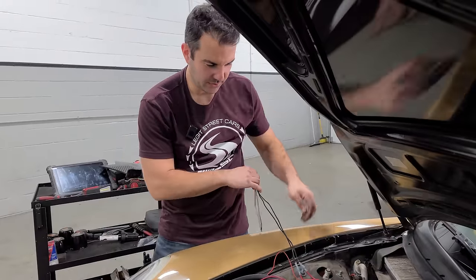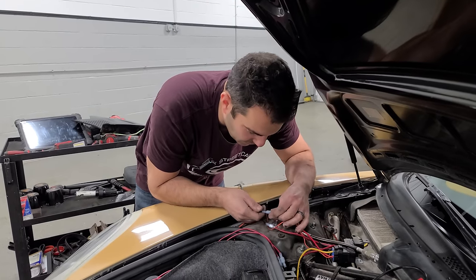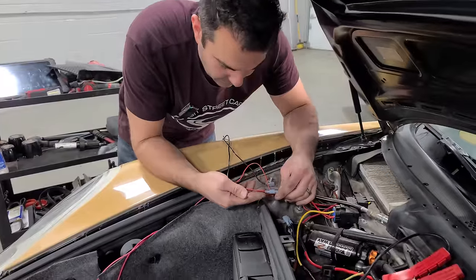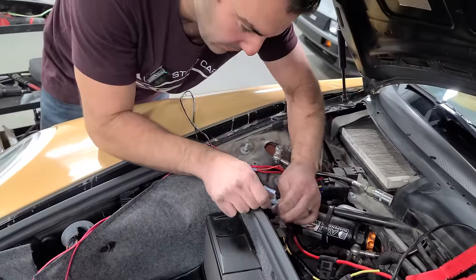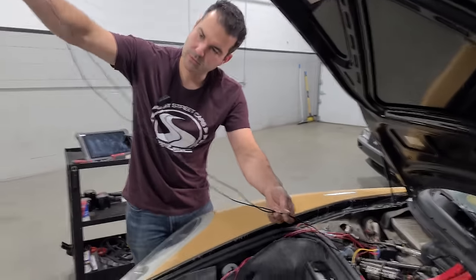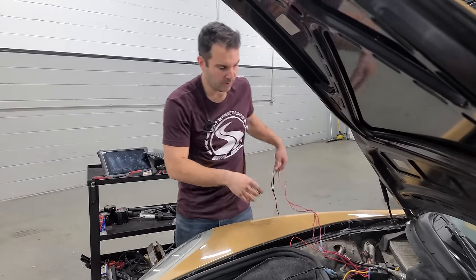We can totally switch these too. I wonder if these things were wired backwards as well. Look at this, they have connectors here, so we could make this be right. All right. Okay. There we go. All right, that won't be confusing now. So these are our two grounds going to our fan motors. These are our two power wires going to the fan motors, proper colors and all.